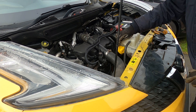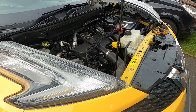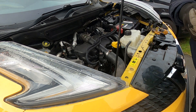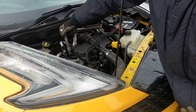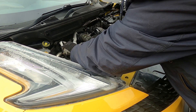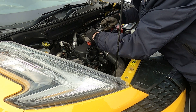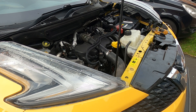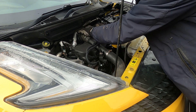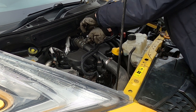You can see it just kind of flexes, so I'm going to leave that just flexing a bit. I don't really want to take the whole thing off. Let's get these two bolts out — they look like 10mm, yep, 10mm. This one looks problematic because of where it is. I'll see if I can use it on the flexi and get in there. That's a problem — I'll go with a ring spanner. Shouldn't be that tight. There we go.